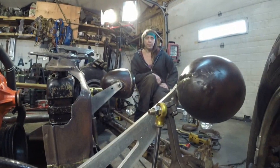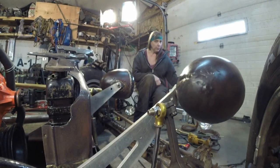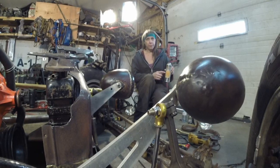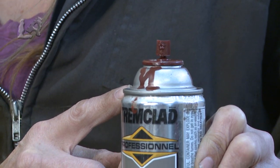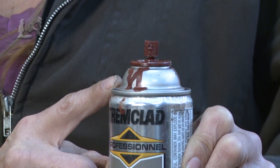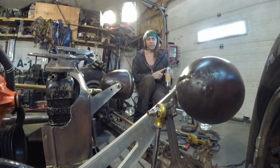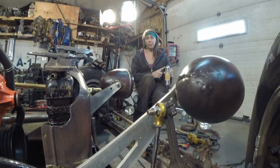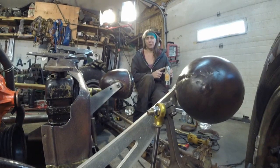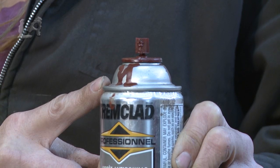One of the products I like to use on these lights is red oxide primer. This is one type of red oxide primer — they use this on metal to store it away, and you can also weld on it. I found it works a lot better than just brown paint. For a patina on a rat rod, it's usually within the realm of red, black, and brown. I try to stay away from the red because I don't want too much red in it. The brown kind of looks more like rust, and this achieves it really well.